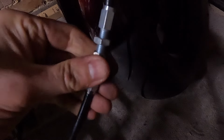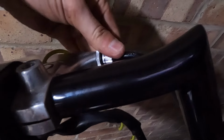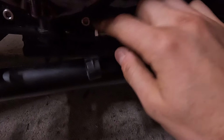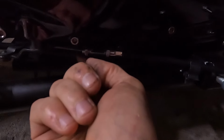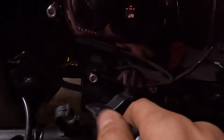So now what we're going to do is wind back the clutch cable, because we're going to have to take the clutch cable off. Down here, wind it back off this one, just so we can take it off here. So we should pull that out now, pull it through here. It's going to be easier just to take the whole thing off. What you need to do is wind that back so this can shoot through like so. And then you've got to get all the way off here like so, and you pull that across. It's a bit of a strange one. You've got the handle there, pull that back on itself so it goes all the way around like this, and once you've done that, it'll come out like that, and then you can easily just pop it off, he says, like that.